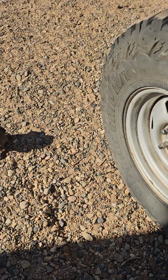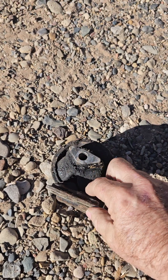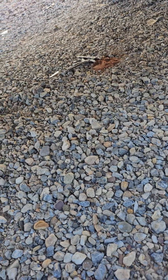So I fixed my transmission mount yesterday and it was still popping out of four wheel low. After my trail test I found that's the old mount — a factory one probably — but it was pretty loose. It didn't look broken but it sure was wobbling around. I turned the light on and got underneath there; I thought my linkage was messed up.